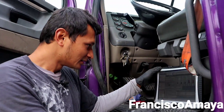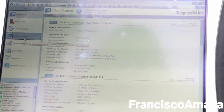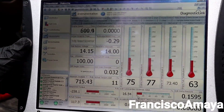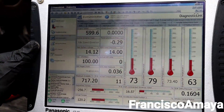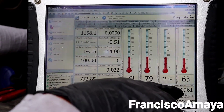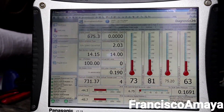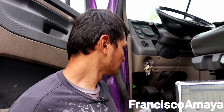To check this out on the DDL software, go to instrumentation and look for EGR. This screen will appear showing the EGR position — how much the valve is open and how much pressure is going through the EGR. This is the EGR delta pressure sensor reading. It closed, got close, went minus zero, opened, went to one — that's fine. It opened more, went higher, went closer, went to one. That means this is functioning, it is working. That's good.